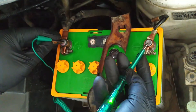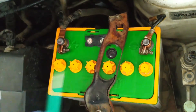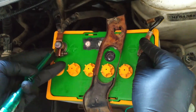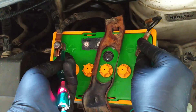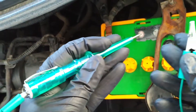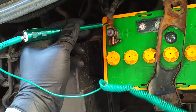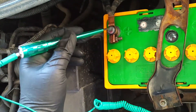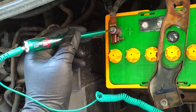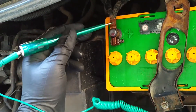While we're here, let's quickly test the connection between the posts and the terminals using a test light. Touch one probe from the test light to the battery post and the other to the opposite terminal — it should light up. Test both sides, positive and negative, making sure you're getting a good connection on the terminals with the probe. If it still doesn't light up and your car has no power at all when you turn the key, you have a bad terminal — replacing it should do the trick.